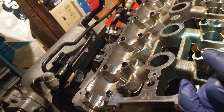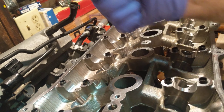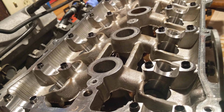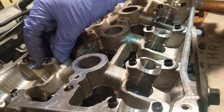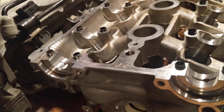There's a way to do this on the heads where people take nylon rope and coil it down into the spark plug holes, then they bring the piston up and it keeps all the valves shut — so you don't have to pull the head off the car if you have to do valve stem seals in the car. Works pretty well. The video I watched on how to do this was a guy doing the rope way.